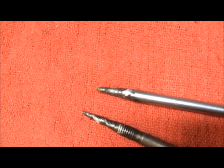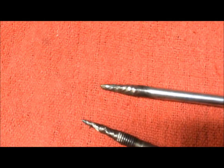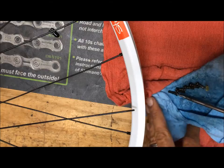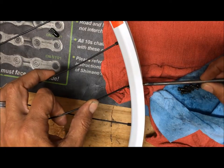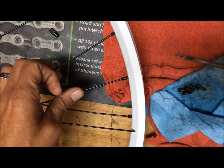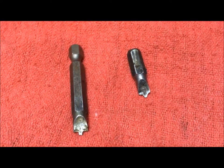You want to grind that on the edge of a grinding wheel, pulling back and turning either clockwise or counterclockwise — you have to experiment a bit. As you're tightening a nipple, it actually gets tighter to the nipple until the spoke bottoms out and ejects the tool.